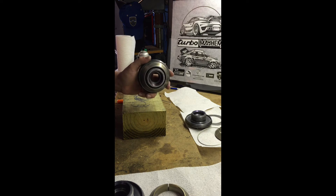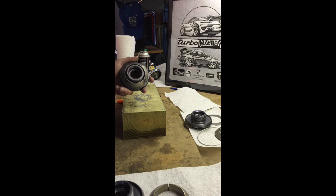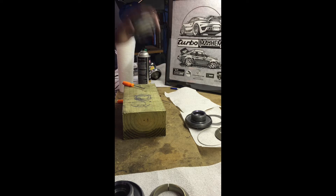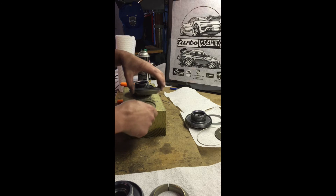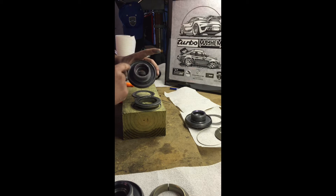We're going to take one apart and show you how that's done. First of all, according to the Porsche spec, make sure you have a block of wood. Take your block of wood, take your center lock nut — more technically correct — and it pops out just like that. You have a couple of different pieces: a conical piece, a little c-clip, and in here you have a washer.